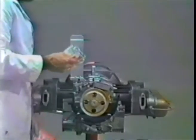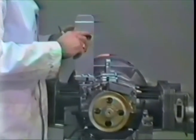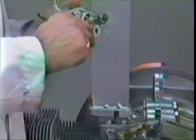You get out your brand new fuel pump, C912 type here, come in a nice plastic bag. You also have to get out from your lower end gasket kit the O-ring seal that fits here on the new fuel pump. They don't provide that. Put the O-ring seal on, quite trivial. Get out some wheel bearing grease. Stick your finger into it. Oh, it feels so good. Put the wheel bearing grease around the spring and on the tip of the plunger.